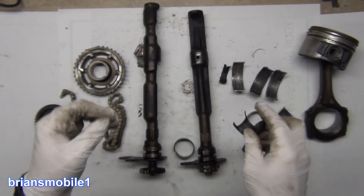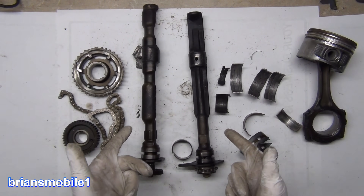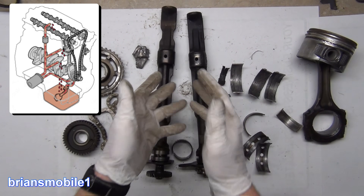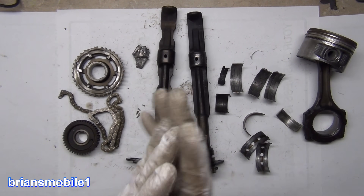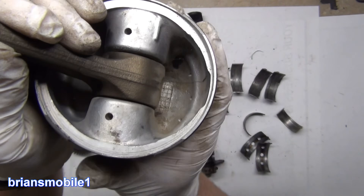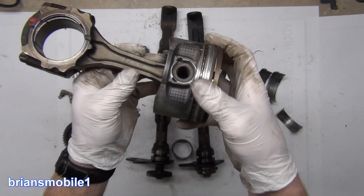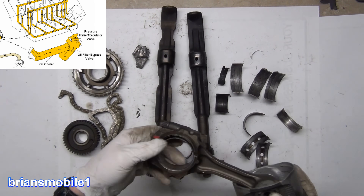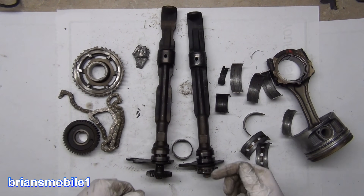Talk about holy smoke — look how dark that is. As for the oil circuit: you've got different circuits pumping oil up to the cylinder head for the camshafts, and it also goes out here. There are all kinds of squirters and things, especially in modern engines. There are rings for the oil as it gets scraped — it'll drop back out and back into the oil pan. There's a whole strategy where if one thing fails, other things are protected. More than anything, it's efficient to just send the oil out to everything all at once and let it drain back in.